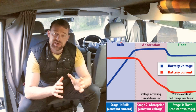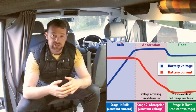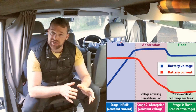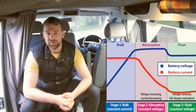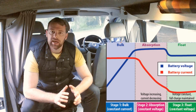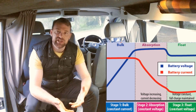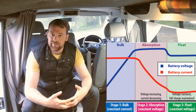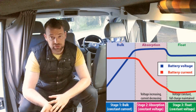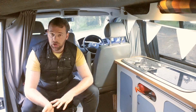If that's the only system you use on your battery, after a year or so you would potentially start reducing its capacity and damaging it to a point where it's not going to run optimally. So you want to think of a split charge system as a two-prong attack. Think of it as a bulk free charge you get when you're driving. It's very convenient, but it's not something that is going to maintain your battery. For that, you want to look at a few other solutions on top.